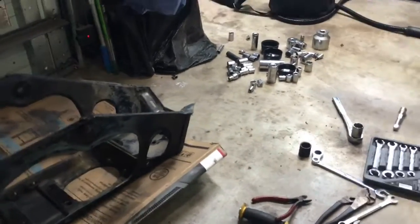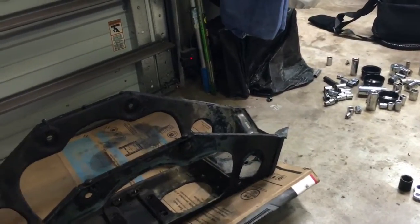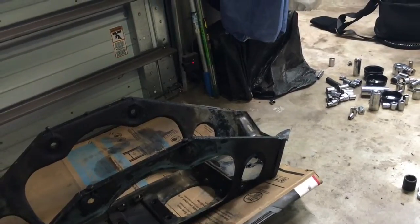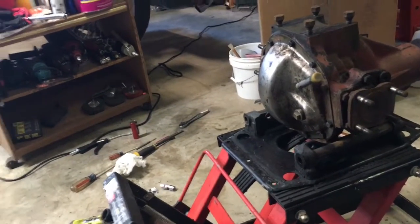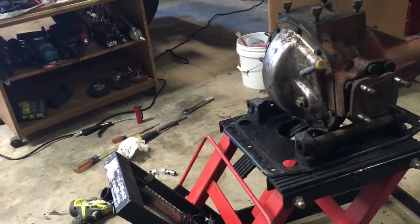Obviously that's going to be more work because we've got to weld that. And somebody was saying that those are galvanized. So you have to make sure you get all the galvanizing off and then wear the masks, because the galvanized smoke is evil. So I think that is about it.